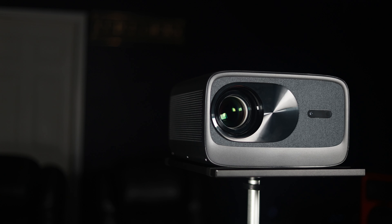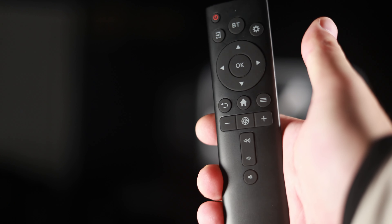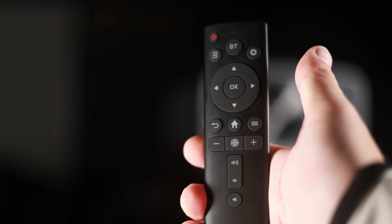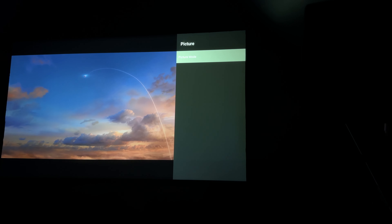When I switched over to the HDMI input I accidentally pressed the menu button on the IR remote control, and when I did that it pulled up both video and audio settings. This is where things get really interesting because I can make video and audio adjustments, and that does appear to carry over onto the Android side. But there still seems to be no way to adjust those on the Android side directly — you do need to make those adjustments from one of your external inputs.